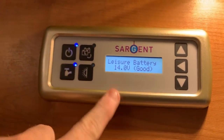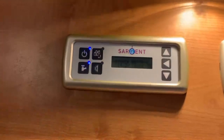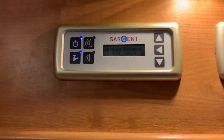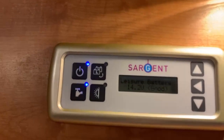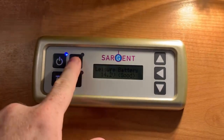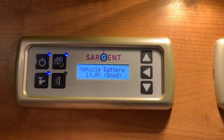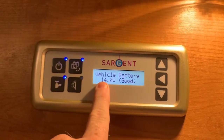The battery swap is going to swap the connected battery, meaning it will switch to the vehicle battery being connected to the motorhome, which means the vehicle battery will power the motorhome. The only reason you would switch is so the connected battery gets the benefit of the mains powered battery charger — switching allows the vehicle battery to charge from the mains electric supply. Only press this button when your battery charger has mains electric power and is working. When you switch to the vehicle battery, you'll see it come up on screen with a blue light to show the switch. The vehicle battery is now on charge.